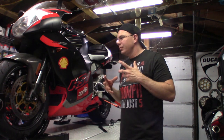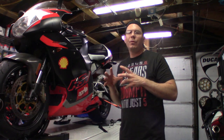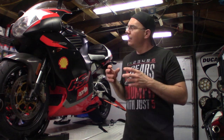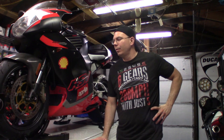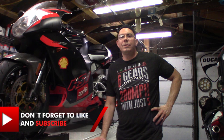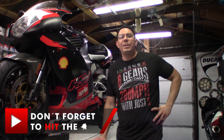This bike really doesn't need an oil change — it sat all winter. I changed the oil a couple months before winter but I was running 20w50 synthetic oil. I'm going to go back to 15w50. On really hot days the 20w50 did help a little with keeping temperature down, but this bike calls for 15w50 and Amsoil came out with a 15w50 that's a great oil. I ran Amsoil 20w50 for two years in this bike, not full synthetic, and never had any clutch slipping issues.